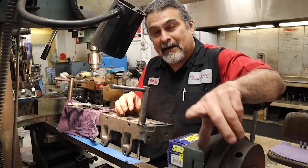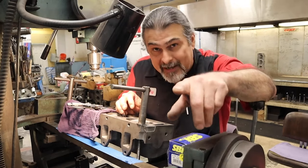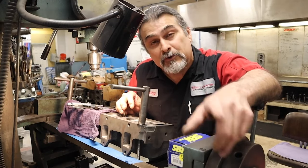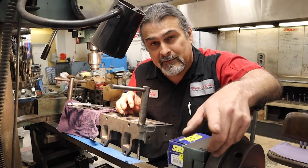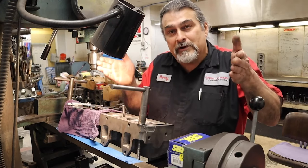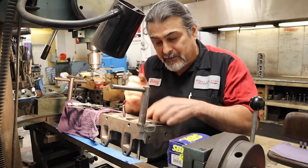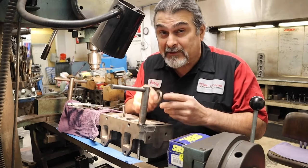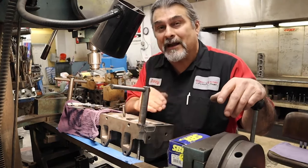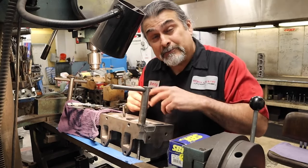Here's a little bonus tip of the day. If you try to put a seat in an aluminum cylinder head and try to press in a seat with seven thousandths press fit in aluminum, it's going to go in — but it's not going to have seven thousandths press fit because it took the aluminum out with it. It rolled aluminum as you were hammering it in, rolled it to the bottom of the seat. It does not have seven thousandths press fit because it took aluminum out with it — and good luck, you're going to drop that seat.